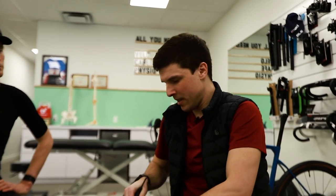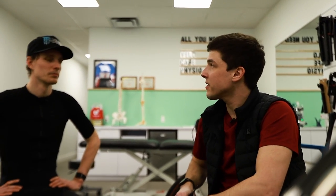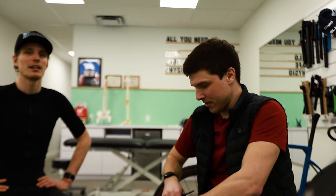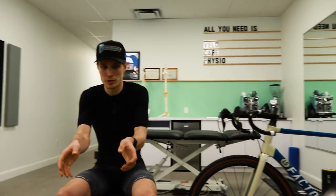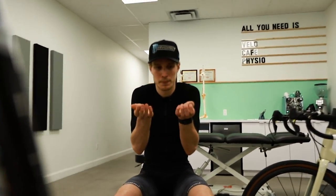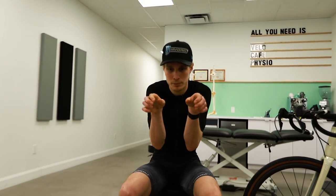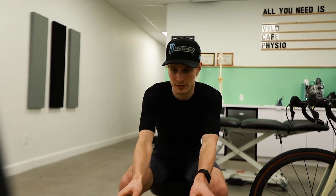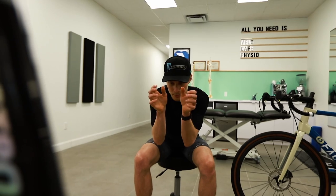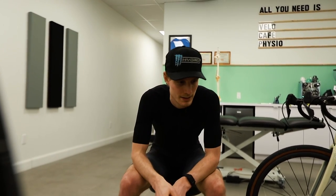Today you will see Adam positioned on the bike. He gets very aero. No matter how low the stem is, it's all about the rider's position. Especially in TTs or even in road biking, it's not because you're lower that you're necessarily more aero. Actually, the higher your handlebar, the more it helps close that frontal area. If you're super low like this, you're more like a parachute than at the same height with your hands like this, because it creates less drag.